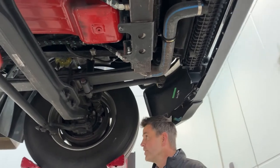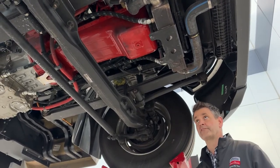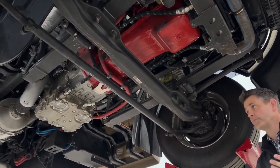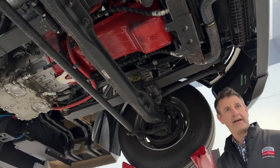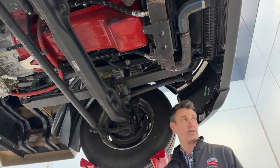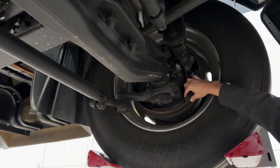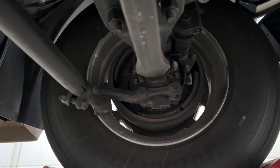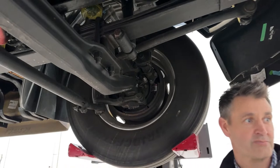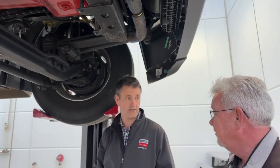Looking at this particular coach, there are a couple of things that make it different from other Class C units. It's air ride in the rear and it also has air brakes, so you have confidence going down the road — a nice ride experience and confident stopping. You can notice the drum brakes right here; these huge pads are going to last a customer about 125,000 miles. In general, most customers never have to do a brake job. Drum brakes all the way around on this chassis.